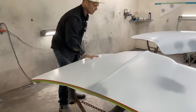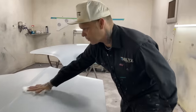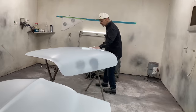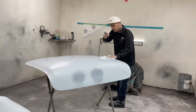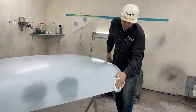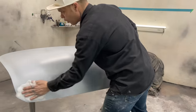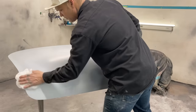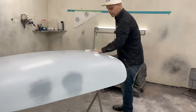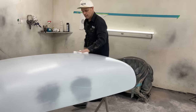I feel my bracelet scraping the hood, but basically, that's what I'm doing. I'm going to paint both sides. I'm going to paint the hood and the trunk lid. I blocked them out. I did the hood with an 80 grit first. That's quite coarse, and I guide coated it, and I did it with a 220, then I did it with a 400. I'm hoping that I get all the scratches out, but I'm not real concerned if I have a couple scratches, because when it comes time to put the car all together, I'm going to probably sand it down and spray it again.